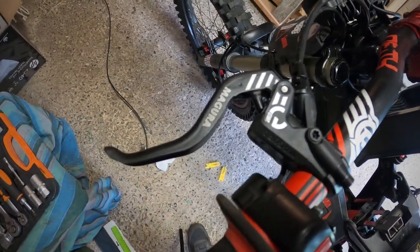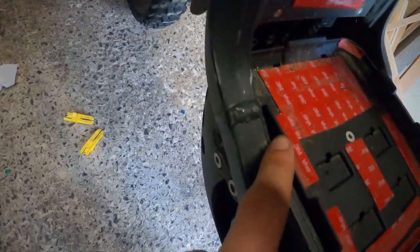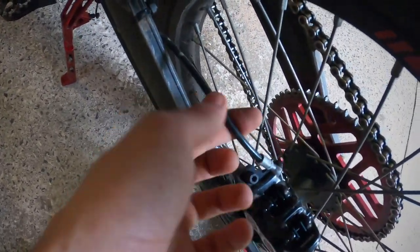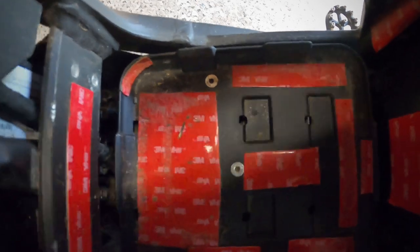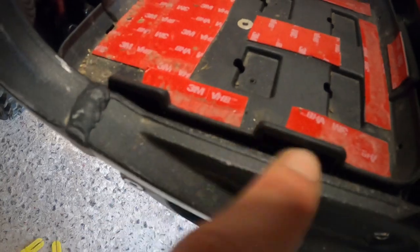I'll just quickly show you how to thread the rear brake cable through the bike. The cable comes down - you'll see through there it goes under this battery tray here and then it comes out just in between there and onto there. There are a few bolts inside here - one there, one there, and a couple in the corners. You probably do want to take those off first, and then if you stick a screwdriver in there you can prise that up. You can just about see the brake cable going through there. Prise that up and then you'd be able to fit the cable through there and then come out there.